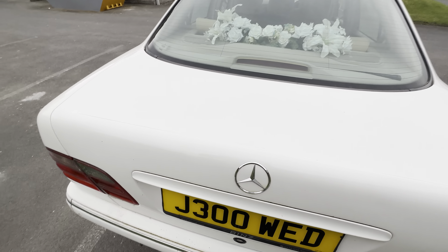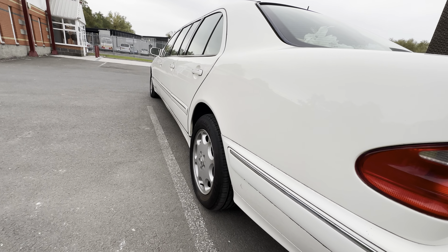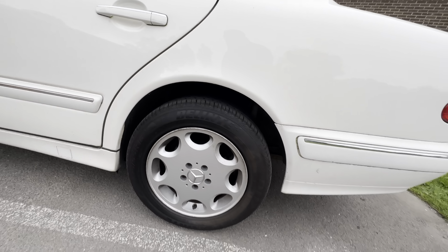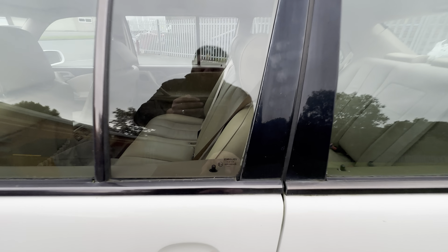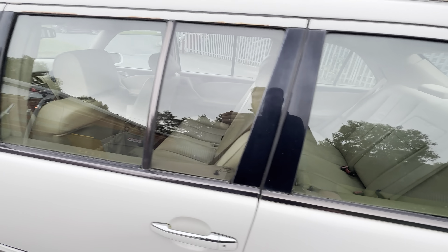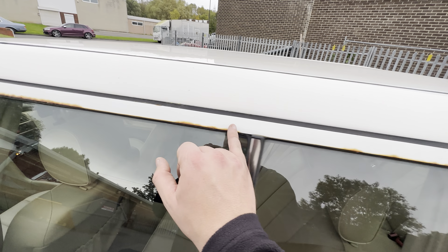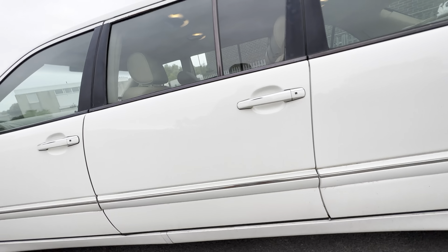The boot lid is nice and straight, around the bottom of the window that's all good as well — there are some flowers in the back and it looks like it's got the blind too. Round on the passenger side, nice and straight all the way down, rear arch no sign of any corrosion. Another good wheel and tire, but the same issue on this side — there's corrosion coming through on this middle door, which is part of the conversion. Your clues are on the window — it's got star glass — whereas everything else is your original make doors. Both sides have that little bit of bubbling on the top. There's also a chip down the bottom of this door where it's been opened on something, and it's just starting to corrode.